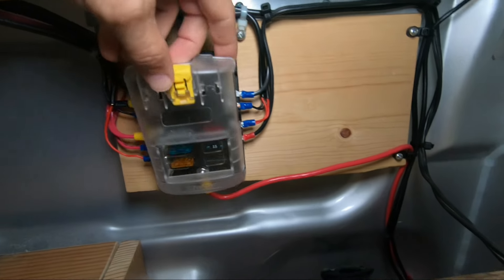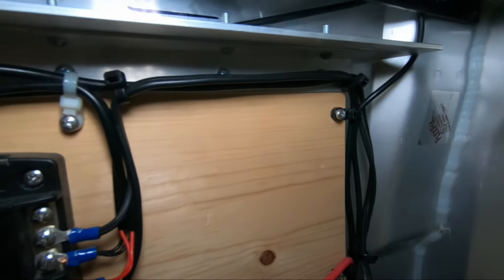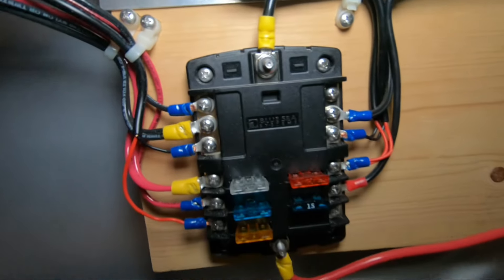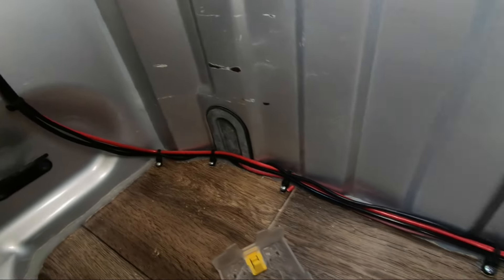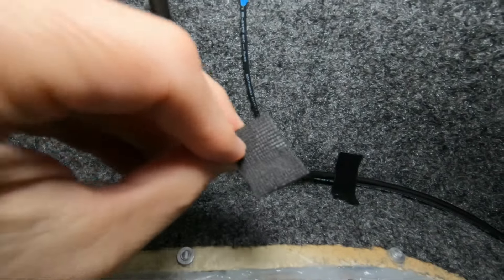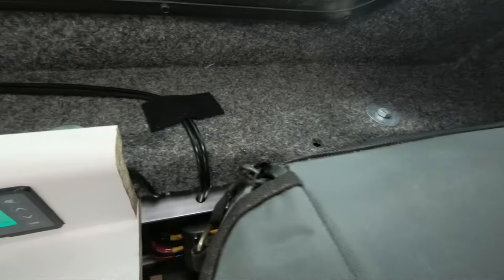You might be wondering how we tie all that electrical stuff together — we have a fuse box here. It's not a huge one, but it's enough to get the job done, and I think we even have an extra space or two. We also try to make our wiring as neat and organized as possible, because you never know when you'll need to come back and track something down to fix a problem. Here's all the wiring coming to the fuse box from the power center. The solar panel cable pokes through the fiberglass roof and we run it as inconspicuously as possible. The carpeted interior wall allows us to use Velcro to neatly secure the wires, including the runs from the fuse box to the dome fans.